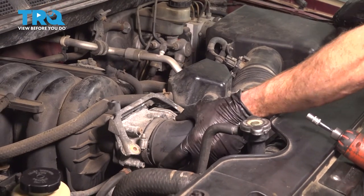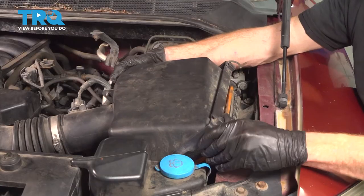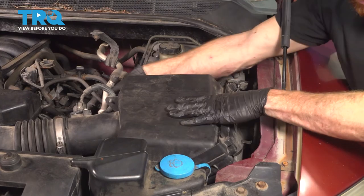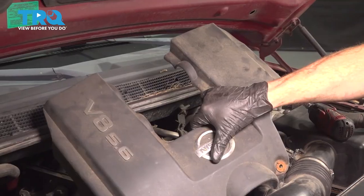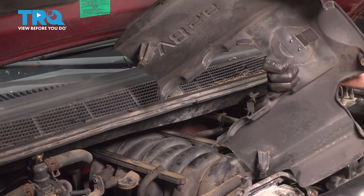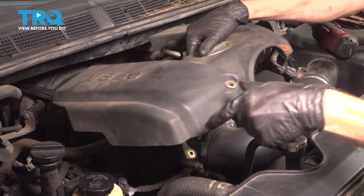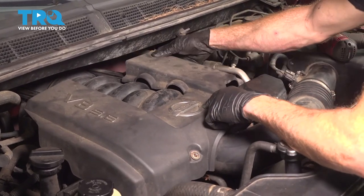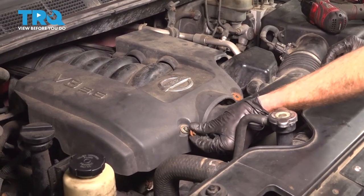Take the air intake and slide it into position on the throttle body. Once you have it on there, continue on by tightening your clamp. Now we can start resecuring our upper clamshell for our air filter box — make sure you have it secured on the far side, then lock it in with your two locking clamps. Now we can put on our upper engine cover. You'll find two little locating pieces that protrude downward — on the engine's intake you'll find some rubber grommets for them to line up with and slide into. Once you have them both in position, press them in. Continue on with your two mounting bolts — start them both in and then snug them up.